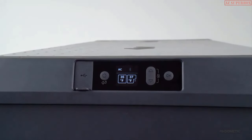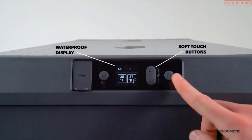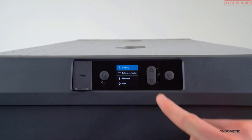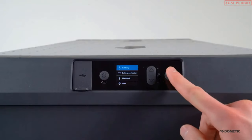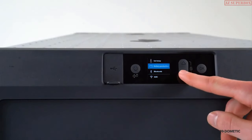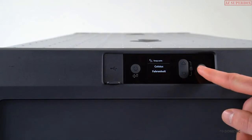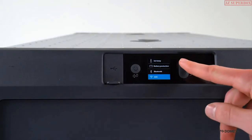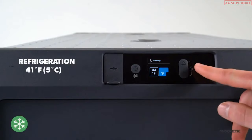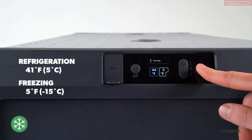The CFX3 features an easy-to-use waterproof high-resolution color display with soft-touch buttons. Pressing the OK button calls up the settings display, while the up and down buttons navigate the menu. Make your final selections by pressing OK. Using the arrow buttons, find CF temp units from the menu for choosing Celsius or Fahrenheit. Next, go to the Set Temp option and press OK. Toggle between zones and adjust compartment target temperature with the up and down arrows. We recommend 41 degrees Fahrenheit for refrigeration and 5 degrees Fahrenheit for freezing.